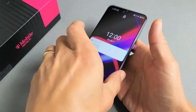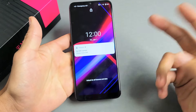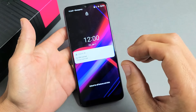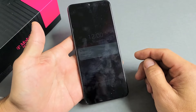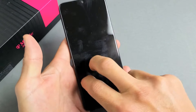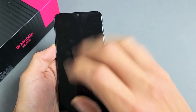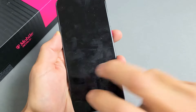For the next step, go ahead and unplug the phone. Now what we want to do is what I call the tap method — we're going to tap the phone all over on the screen and all over on the back. Sometimes something gets slightly dislodged and a simple tap can pop it back into place, and all of a sudden your screen may come on or it may even reboot. Use two fingers and tap kind of hard all over. Sometimes the phone might just restart and start working, or sometimes the screen will pop on, or you may get white lines, or half the screen will pop on.